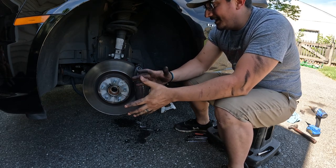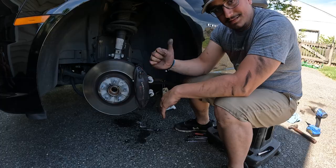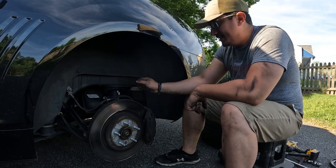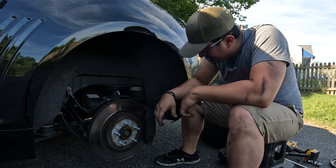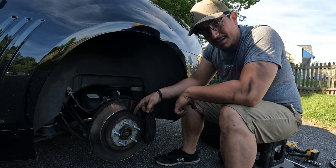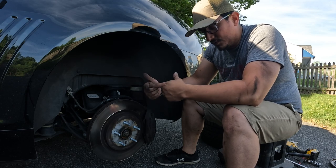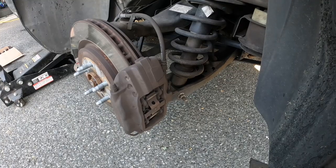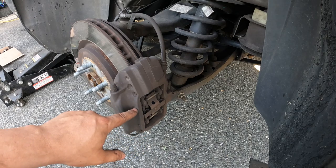The other side is the exact same — we're not going to worry about bleeding it right now, we'll move on to the back. In the back, the setup is pretty similar — two pins, a hold-down bracket — and we're going to swap out this line. I'll probably soak the whole place with degreaser because it's filthy. Behind this rotor is the parking brake. I got stuff for it, but let's see how it looks — if it's bad we'll swap it, if it's good I'll leave it.